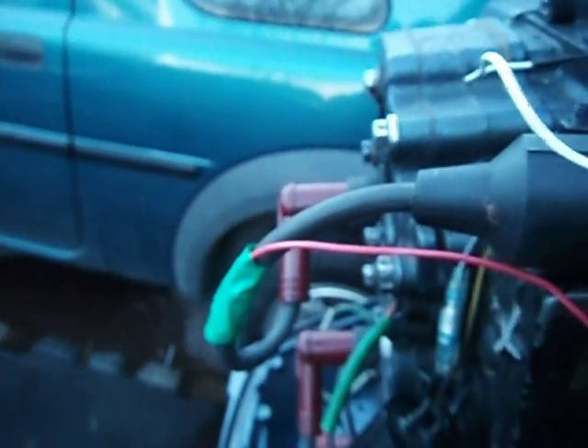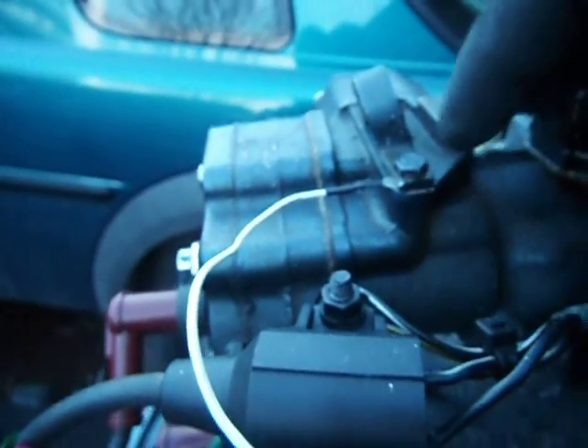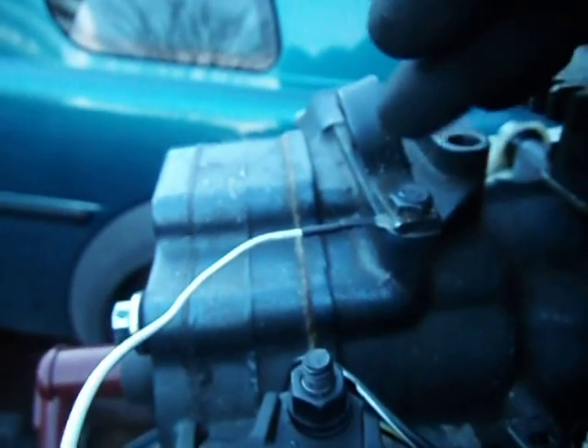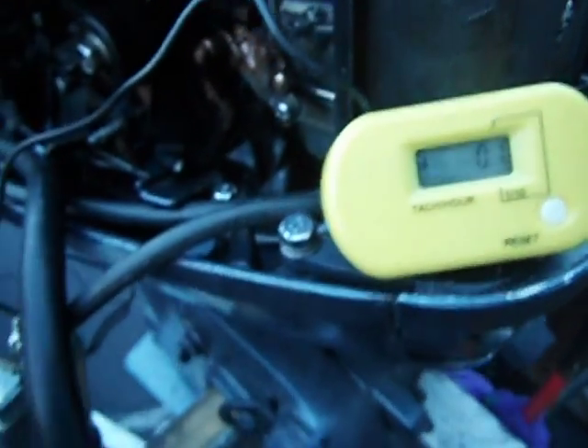I'm going to do a quick video on how to set the taco up. I've made my connection to the coil and it goes to cylinder number one, the top cylinder. This is the same for Yamaha and Tohatsu. You need to make the white wire go back to a good earthing point — I've put this one under the engine lifter, which is a good earth. Ideally you should run it back to one of the earths where the coils go back to. Once you've done that, go to your taco, make sure you've got plenty of water running through your engine, and start it.